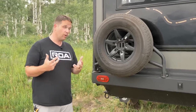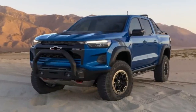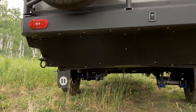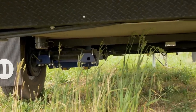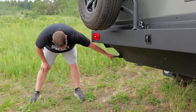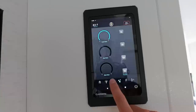Any Ford Raptor or TRX — I would even say if you get the base model, you could pull it with maybe a max-tow package Gladiator or potentially the new Colorados. A lot of those have tow ratings of seven to eight thousand pounds, which really puts you in the range of this trailer. Down underneath here, water capacity is 54 gallons of fresh water, and then you have 30-gallon gray and 30-gallon black tanks. Right here we have the D-ring recovery hooks — these are integrated into the actual frame and you'll be able to yank the whole trailer out with these.